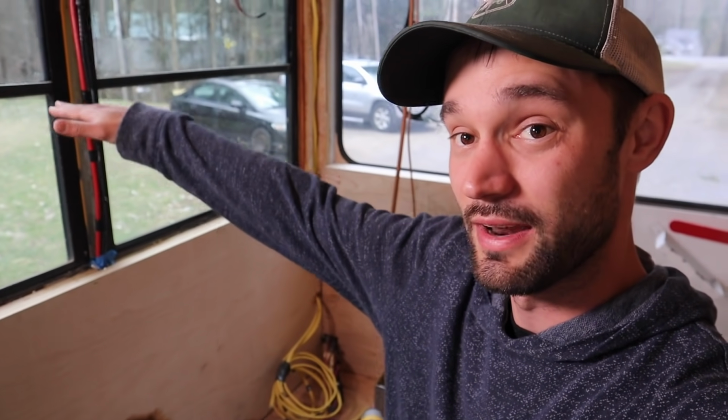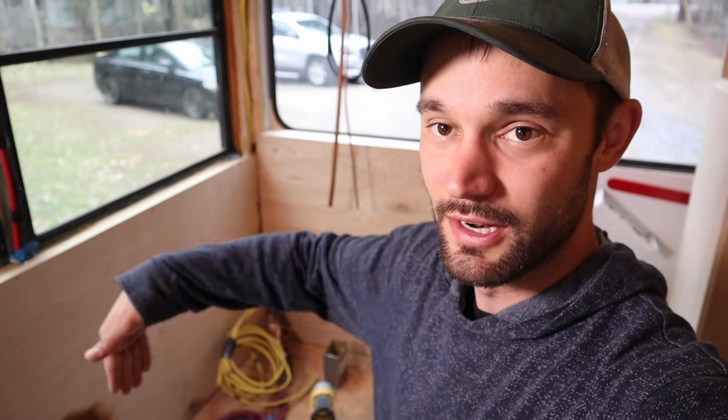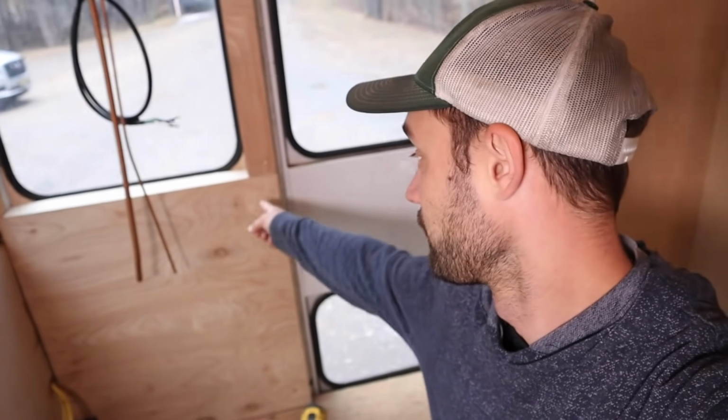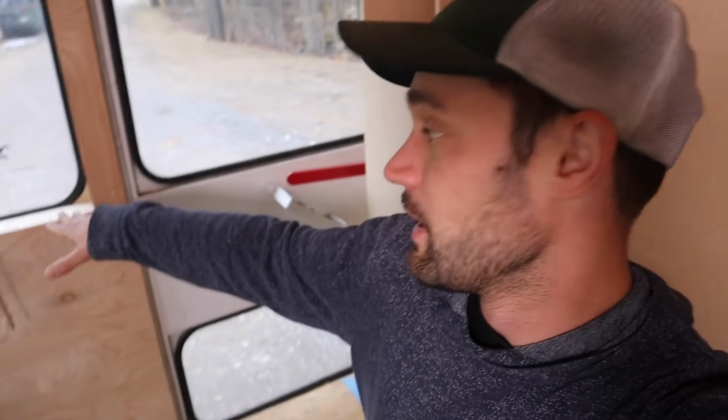So what we're gonna be doing is building a backrest just like you saw on Navi. It's gonna be about 36 inches high for the backrest all the way down to the floor. And then the actual seat is gonna be about 19 inches off of the ground. And then it's gonna come out about 24 and a half, which will bring us to about right here before the door. And then the pullout will be about 22 inches and it will pull out to almost meet up with right here. So that when we're all done, you have a bed that goes wall to wall. And when you pull it in, you have a nice comfortable couch that we adjusted for those measurements that we talked about in Navi that weren't correct.